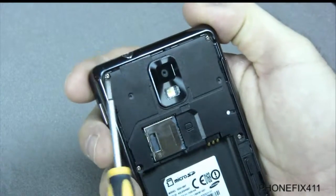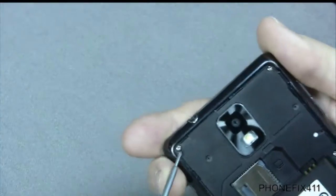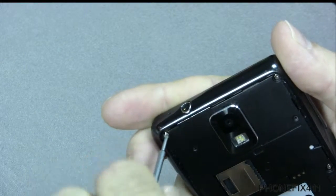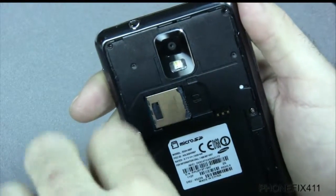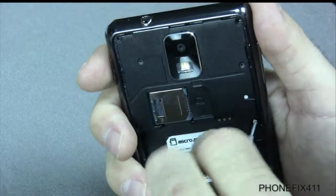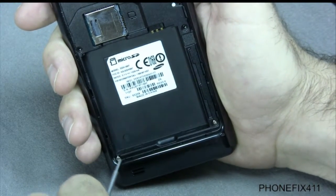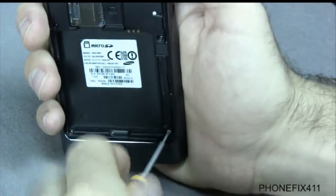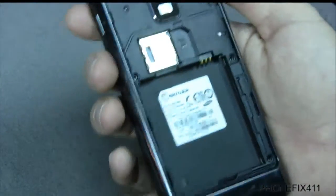To actually get into the repair, you're going to have six screws — one, two, three, four, five, six. Remove those six screws and set them aside. One important thing right off the bat: keep everything in order. I even put the screws I remove in a specific order so I know what came from where. The last thing you want is to be reassembling the phone and not remember which screw went where or how something fits back in — on some phones you almost need to know exactly how everything went in, or you could end up damaging it.